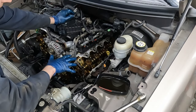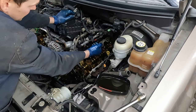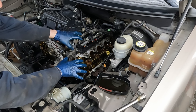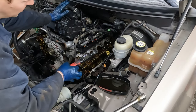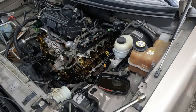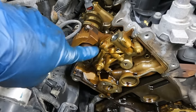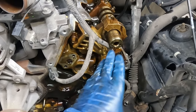Take our middle cap and put that on - not tightening the middle one down yet, just snugging for pressure, finger tight. Then lay all of them on. Tightening is the same as removal: start on the big cap, then the far back one, moving toward the middle. Torque to 89 inch-pounds - snug them down walking the cam back in place before final torque. Go back through and double check your torque. The only difference on this side: when putting the cam back, the keyway faces slightly up at 45 degrees, opposite to the other side.